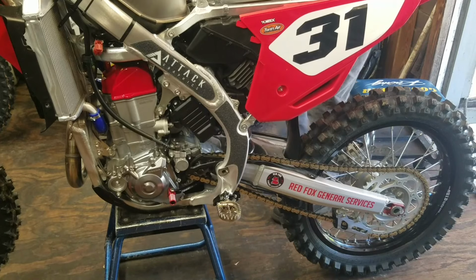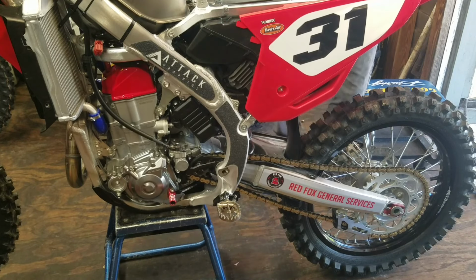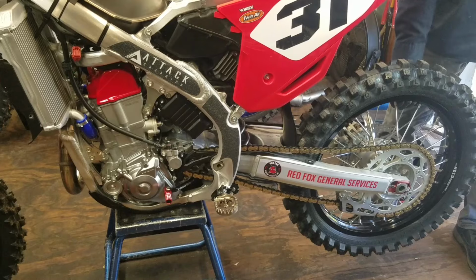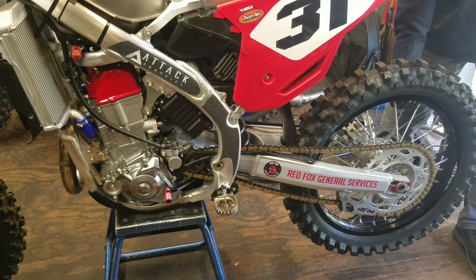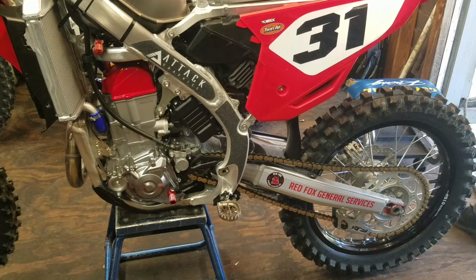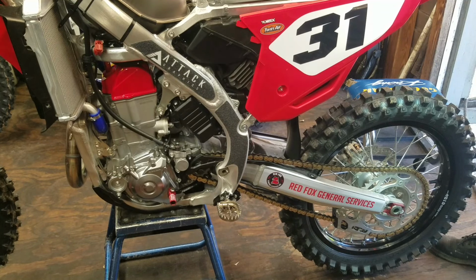All right. So if you tighten it up while it's on the stand, it's going to be at the bottom of that play, and it's just going to knock things off. It'll probably eventually work its way up to the top end of the play after you start jumping some big jumps. But it's definitely going to make your bike feel funny for a little bit until that happens.